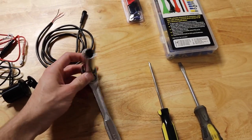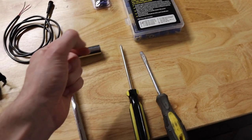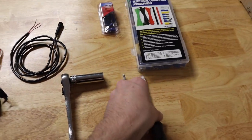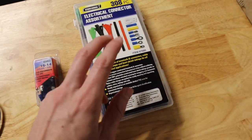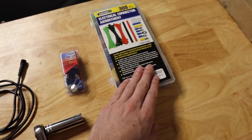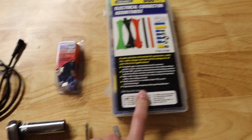To remove some of the panels we're going to be using a Phillips screwdriver, a 14 millimeter long socket for the AC controls - there's a nut back there - and a flathead screwdriver to take off things like the AC knobs, which can be a little hard to remove, so wedging the flathead in there will help. I also have these quick-disconnect ends for a cleaner install, plus some zip ties. You can pick these up at Harbor Freight for less than 20 bucks and they come in pretty handy when doing electrical work.